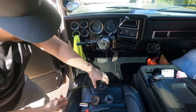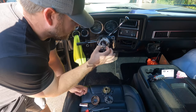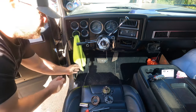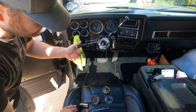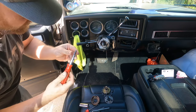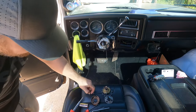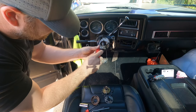The lock plate should come out - here's that little snap ring. The snap ring might have to wiggle a little bit. Get the lock plate off - there's a spring and a little retainer that presses down on the bearing. Now you're gonna need to remove the turn signal switch. It's just three Phillips head screws - you actually have to get the turn signal lever into position to get one of them out. This one only has two because apparently someone lost one at some point.